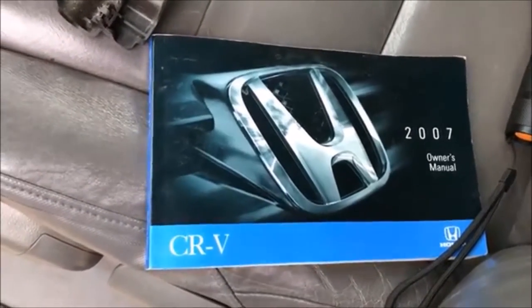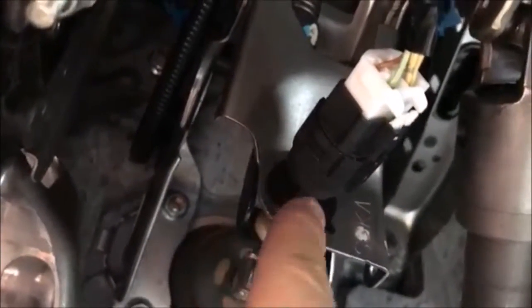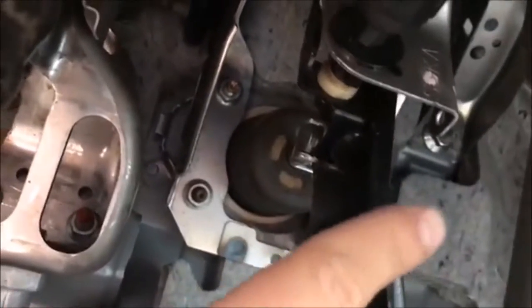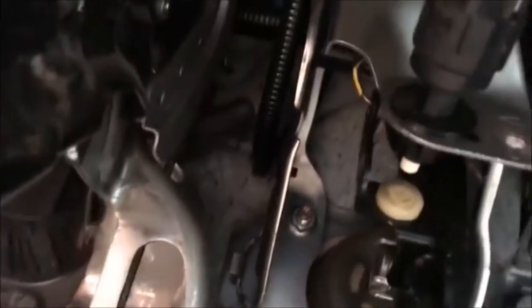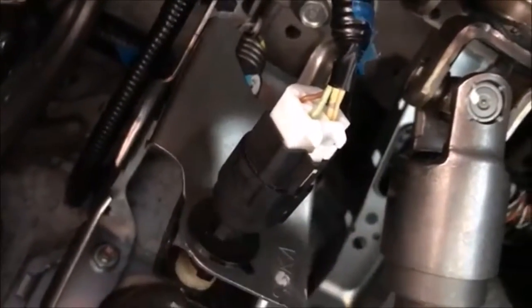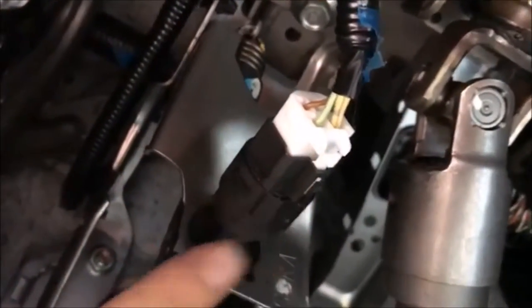What I ended up figuring out was that there must have been a faulty brake switch connected to the brake pedal. If you get under the car, it's this part right here. When you push in the brake it pushes this back, and when that happens the connection is no longer in contact — that signals the lights to turn on. When it's depressed, it turns the lights off.